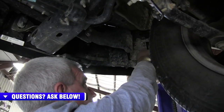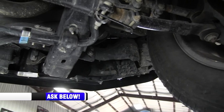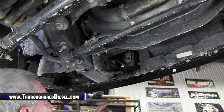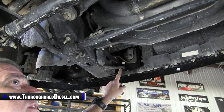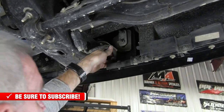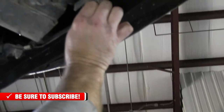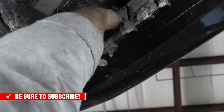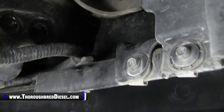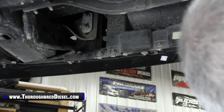Get your 8mm in it and you're safe. Go back through and get all your bolts in and get everything lined up. On the driver's side bolt that comes up through the bottom, there is a clip on your fog light wiring harness — if you've got them on the package, make sure you get that clip pushed back down on the bolt. Don't over-tighten these — you just need to snug them up, don't go back with air tools. Just snug everything up and don't twist the nutserts out and you should be fine.